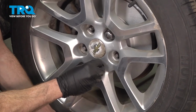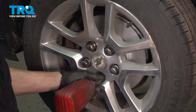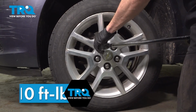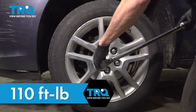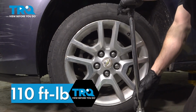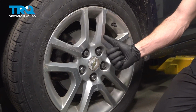Start on all 5 of your 22mm lug nuts, bottom them out. Once you get the wheel back on the ground, we're going to torque each of these to 110 foot-pounds. Let's torque these in a crisscross manner. Torqued. Okay friends, we finished installing our flex hose. At this point, you can go ahead and close the hood and take your vehicle for a road test. Thanks for watching.